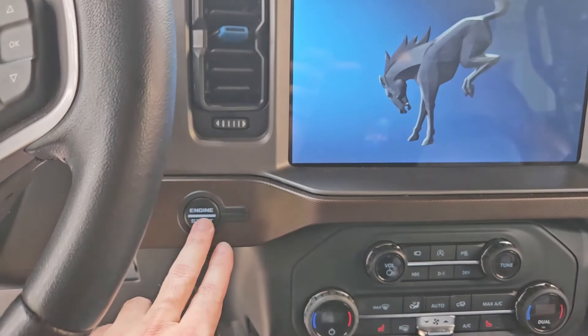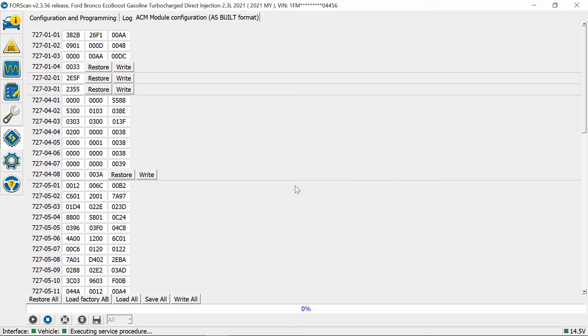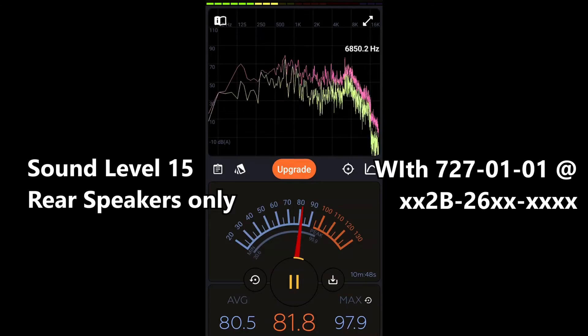Cycle ignition off, back on, and see how that sounds. So if you do change the back speakers and you keep the equalizer on — if you make it speaker-tweeter but keep the equalizer on — it still won't sound right. You have to remove the equalizer AND make it speaker-tweeter, and then it'll sound perfect. Try it, guys.